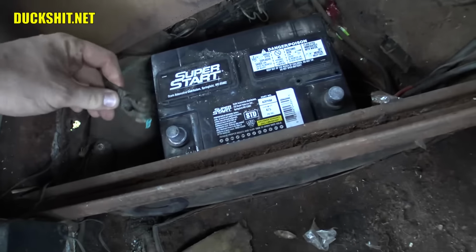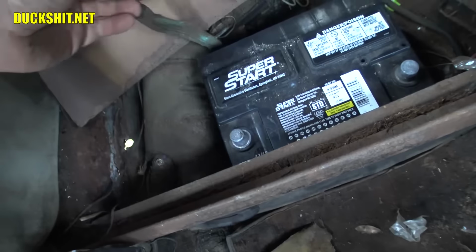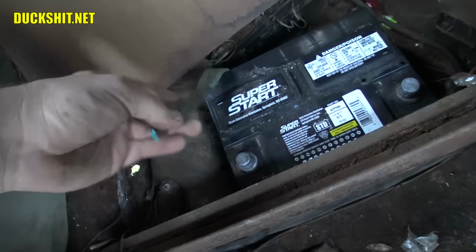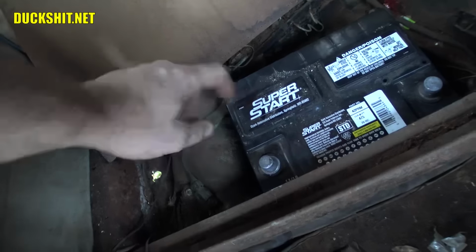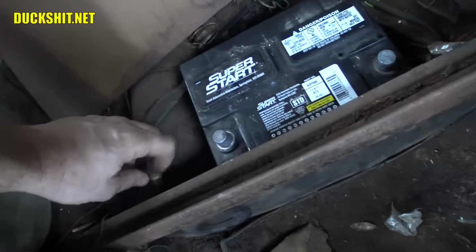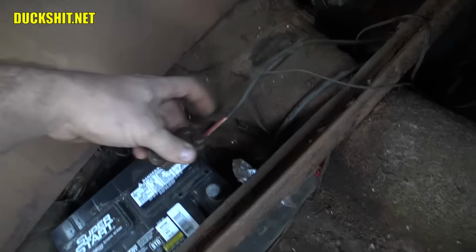Alright, when you connect these batteries, you want to make sure your negative and your positive are in the right spot. Here's the negative. Sometimes Volkswagen negative wires are brown or even sometimes red. So observe that. The battery ground cable is actually attached to the floor pan typically, and the positive one is attached to the starter. It also goes off to the voltage regulator that way.